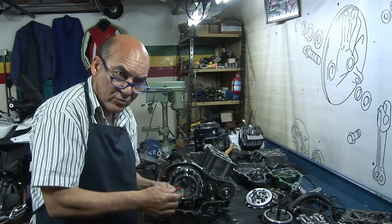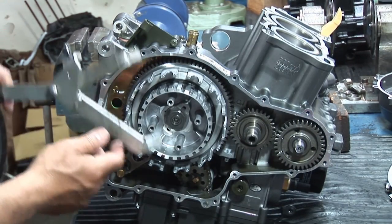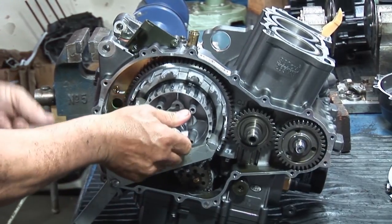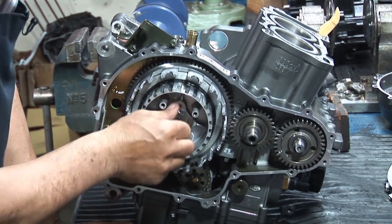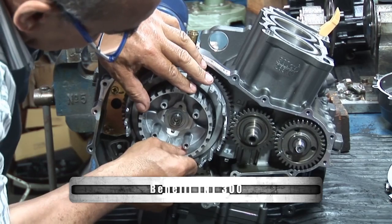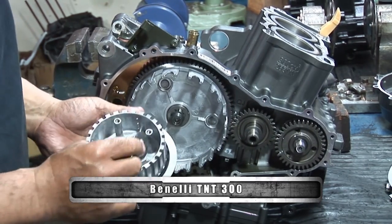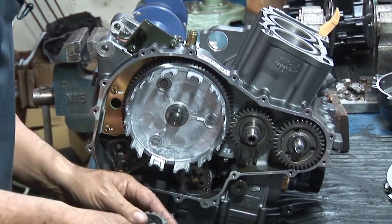Unfold the locking washer. I have this tool ready — it's been without an edge for a long time, just for these things. The clutch center lock is universal; if you don't have one, make it yourself with two pieces of iron — it's simple. It uses a 27mm socket on the primary shaft. We loosen it — fortunately no thread-lock was used; it's just the security washer, not glued, and it comes out easily. On some nuts they apply loctite, on others — especially well-developed engines — they feel it isn't needed.